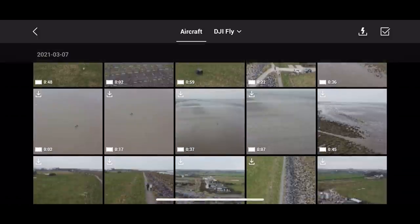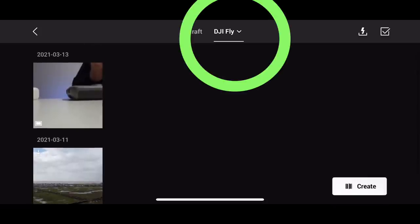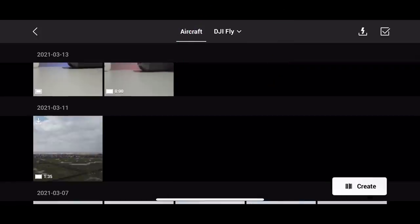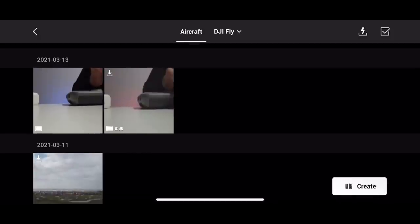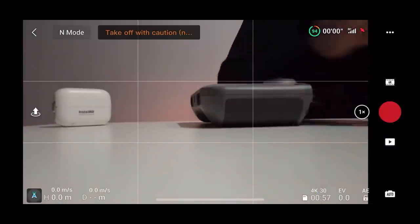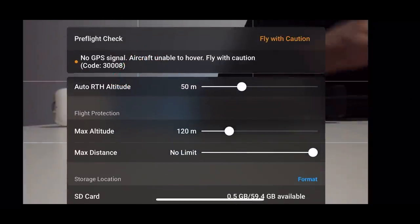You'll also see a little play marker on screen — click on that and it will show you the files you have recorded. You can scroll down to see recent footage, and these are stored on the memory card on the aircraft. If you don't have a memory card inside, you'll have DJI Fly cached storage, which is much lower quality. So get into the habit of keeping the memory card in the drone — you'll get the best quality and it's a lot easier when editing.